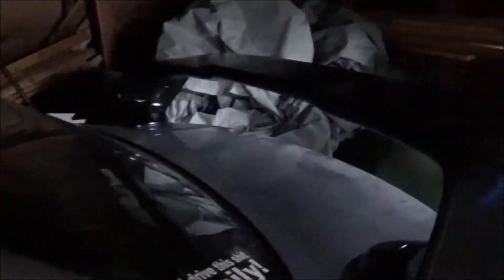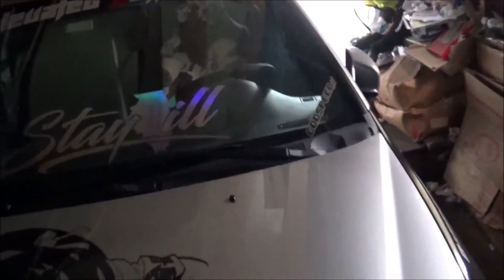I can't turn on the car to put it out in the light because the engine is still drying from when I washed it earlier. There's a dent down here I'm about to try to knock out. I'm gonna use the heat gun to heat it up, get under there, and hit it with a mallet and pop it out — see if that works.